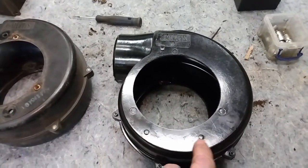There's the completed blower assembly with brackets installed. Now I just have to figure out whether these holes on this bracket are supposed to have a rubber bushing — the holes are fairly large. After a little bit of research, I determined that these holes do not have a grommet in them; they just bolt directly through, and my assumption is that just allows a little bit of wiggle room to move this about. I've got the ground wire securely attached under that bolt up top. Now that that's all in, I can get to work on the heater box.